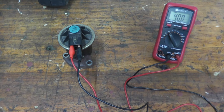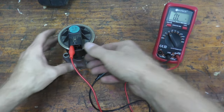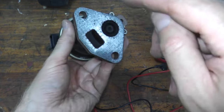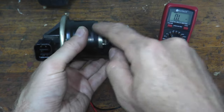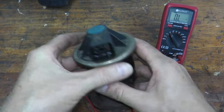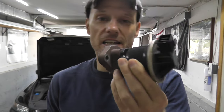This is a 100% working EGR valve. In my case, I don't have a trouble code — I'm just doing this as a how-to. Typically, carbon buildup is the issue, so do that valve test. If the plunger is moving correctly, chances are the valve is in good shape, but you also want to check the resistance. And that's all it takes to simply test and replace an EGR valve. I hope this helps a number of you out there, and thank you for watching.